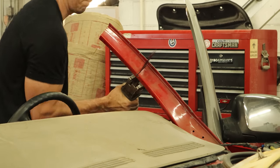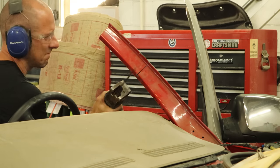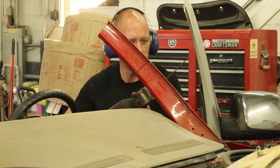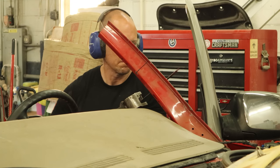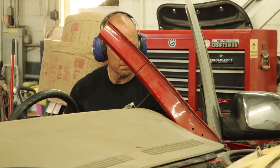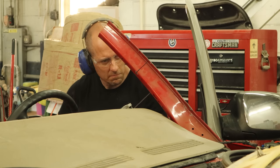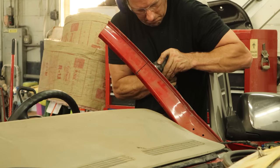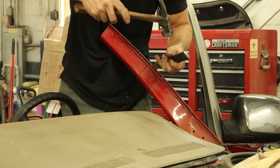A lot of people think you just cut a straight line and weld it up. No, that's not how you do it. You stagger the pieces to make sure that they're stronger, so that you have the same quality that you had before. So now we're going to cut the outside piece a little bit lower — that way we don't have one solid joint where there could be a weak spot. If we had cut our upper piece all the way through the outer piece, it wouldn't have made that much of a difference since you aren't going to use that anyway. But it will make a difference when we want to use it for a template, so that's why I tried to save it.